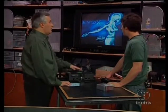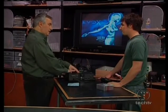And you just transfer them over to the main hard drive. Correct. Got it. And then it'll boot without the DVD from then on. It boots exactly. You can take the disk out and no problem whatsoever. It'll just boot like normal. Do you have to change the boot sector, the master boot record or anything? No, nothing like that. Just drag the files over.